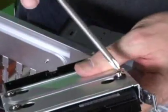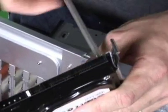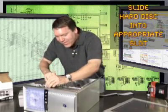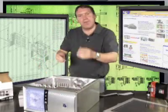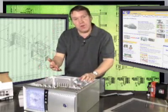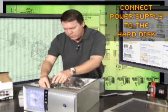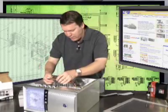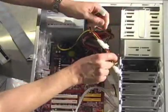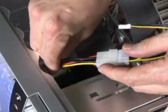We're going to put those four screws in and drop the hard disk back into its appropriate slot. Snap — and it's in. Now there's a set of jumpers on the back that you have to set; we've taken care of that. You have to supply power to this drive. Any of the power cords coming off the power supply are all the same, and if they fit in the hole then it's good to go.